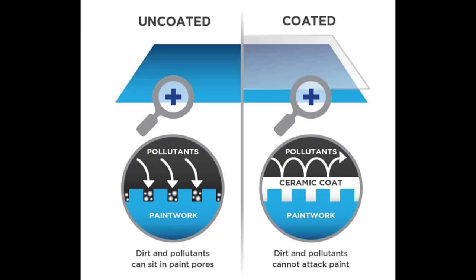The difference between waxes and ceramic coatings is pretty substantial. Natural waxes like paraffin wax or waxes made with carnauba oils sit on the surface of the vehicle and will rub off or wear off — they're not bonded to the surface. Ceramic coatings are engineered to actually chemically stick to the surface of the paint. It's a nano product, meaning the particles are very small; they get into the surface of the paint, chemically etch in, and last a lot longer. They produce a better shine and are much easier to maintain.